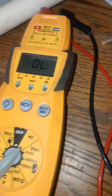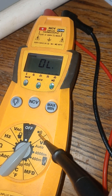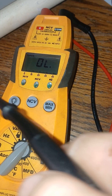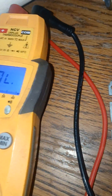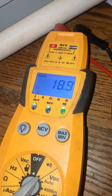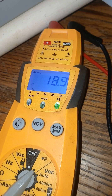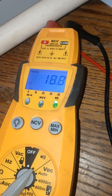Do keep in mind — be sure your power is turned off to the system. We've got it in and we have continuity. Turn the backlight on, go to this side here, touch it, and we make continuity. So at 18 to 19 to 20 ohms, this would indicate the coil is good.